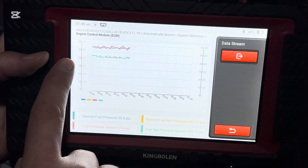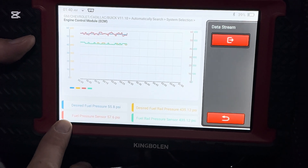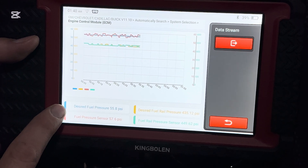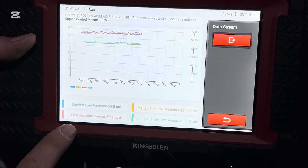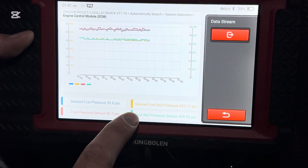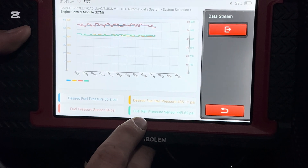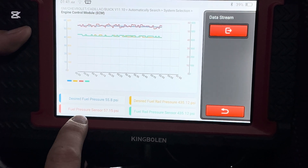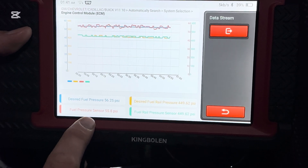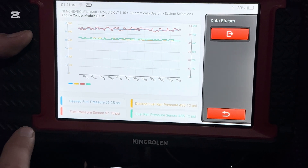The good thing about the layout of the graph, you can actually see the values going across in a live stream, and at the bottom it has a nice comparable feature. You can do your desired fuel pressure and look directly below it at your actual fuel pressure. Over here in the yellow you can see your desired fuel rail pressure, and just below it, compare your actual fuel rail pressure. The values do fluctuate on the actual readouts compared to the desired ones, and that is OK — it is fluctuating around where we want it to, so now you know that you don't have any issues with your fuel pressure.